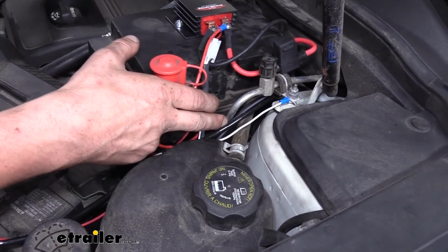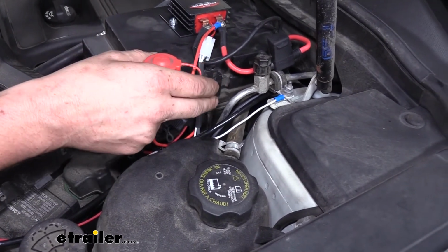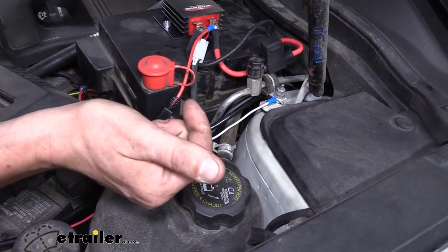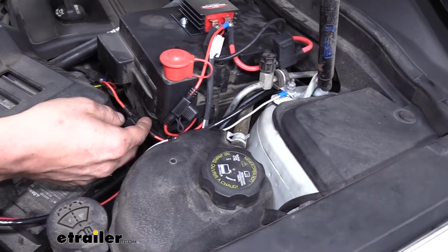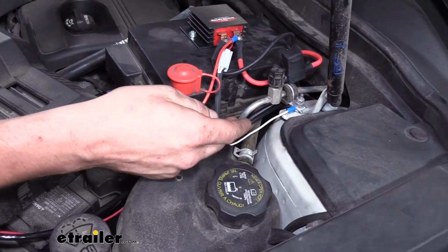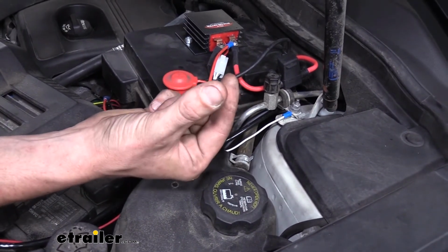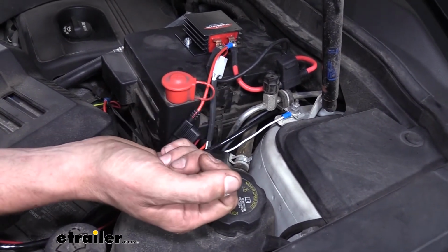The 2 black wires will connect to your stoplight switch. One of them, when it comes out, we hooked it to our fuse harness to get power. The other one goes to the front and is going to give us a small female bullet connector that we'll use for our monitor light.